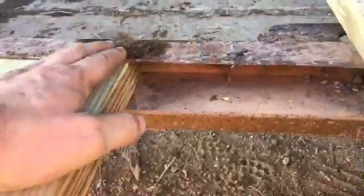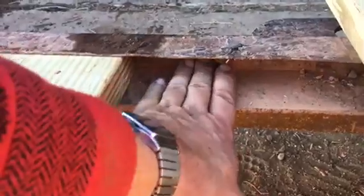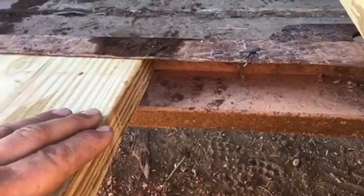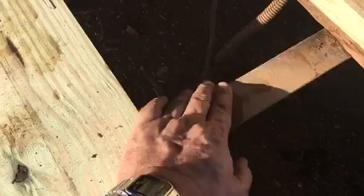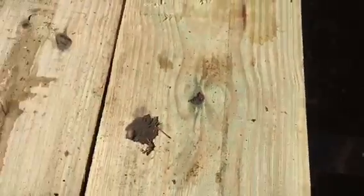On the back side of the trailer, there's this piece of C-channel, and the wood is fitting under here, so it's actually a snug fit. And I believe we're replacing the original boards here. By doing so, we are actually going to pre-drill and screw these boards down too. And I think that's going to make the trailer ride a little better and give it a little more stability.